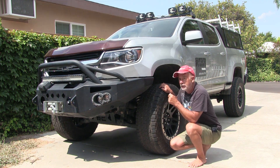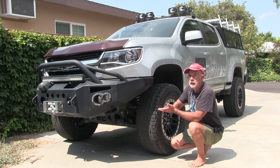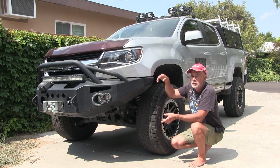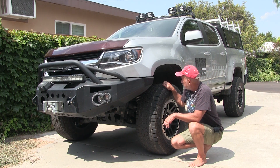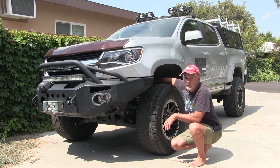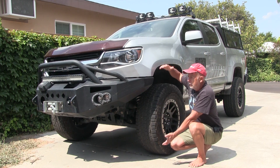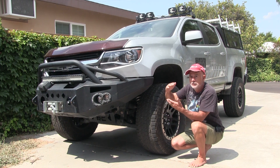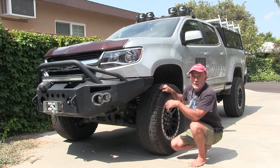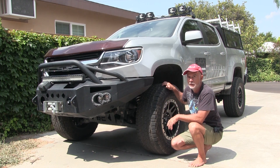I'm showing what I went through to upgrade just the front struts, because there are shocks or struts specifically made for these lift kits. Every lift kit company offers their version — it's just a longer shock. There are a couple aftermarket versions; BDS offers the Fox 2.5s. But the suspension travel is only about the width of my hand, so a bigger shock isn't really going to give you much more travel — you're limited by the axle shafts and tie rods.